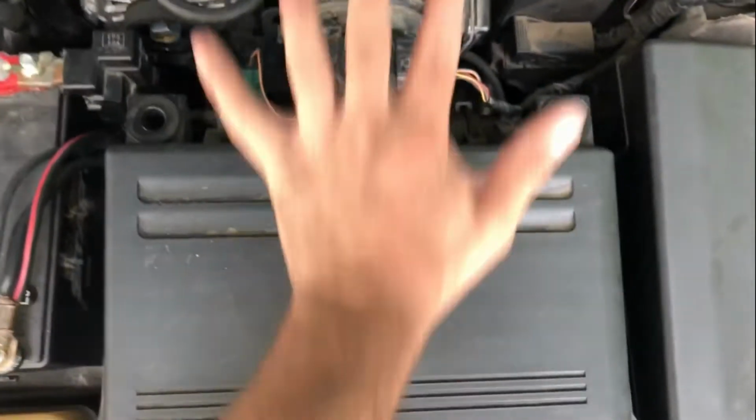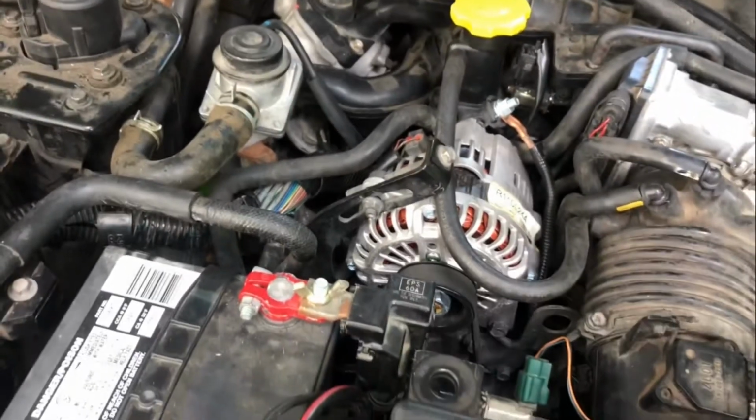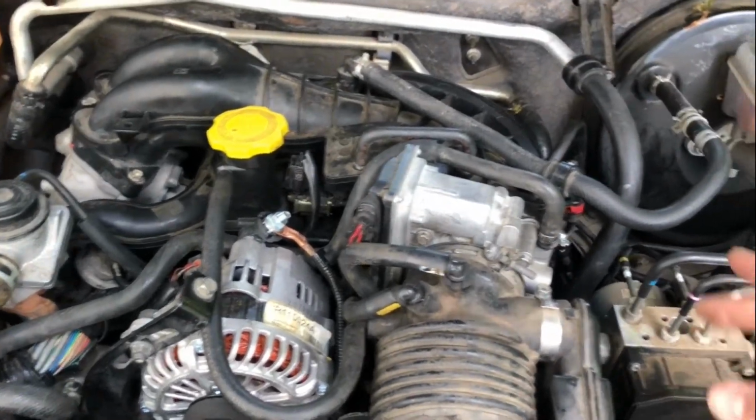Of course, again, you slide it in this direction and you go back this way, retighten the screw, put the 2 vacuum hoses, your mass airflow sensor connector right here, the vacuum line underneath it. Once that is done, go over the whole setup. Make sure all your screws are in their proper position. Your electrical connectors, the ones in the back, your fuel line, vacuum lines.